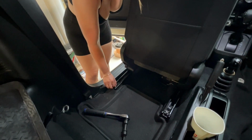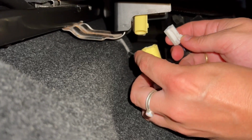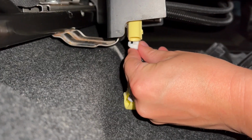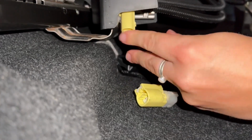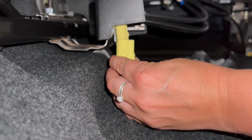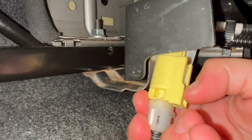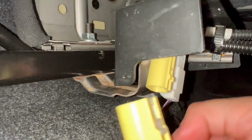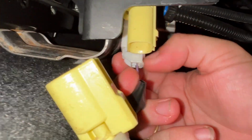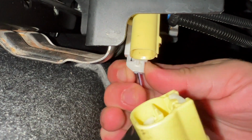Alright, once you've secured both seats in place, you want to jump underneath the seat and you should have a yellow and a white tab for your airbags. They're a simple push-in clip, and then in the next video I'll show you how to pull them out. So the yellow clip, you simply need to pull down on here and give it a good tug. And the white clip is just a push-in from the other side. You should see where my pointer finger is. Point, and squeeze and pull down.